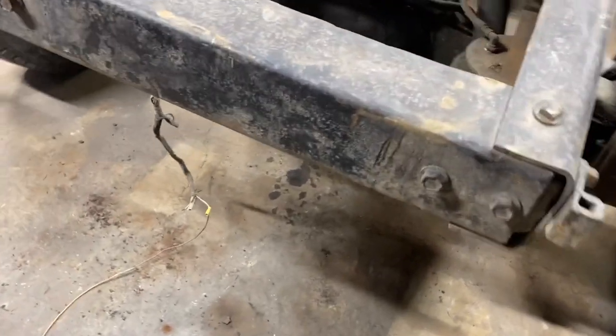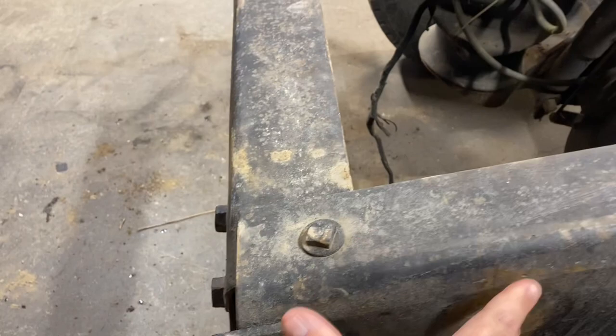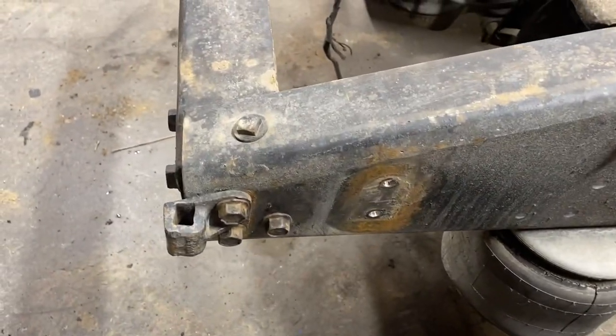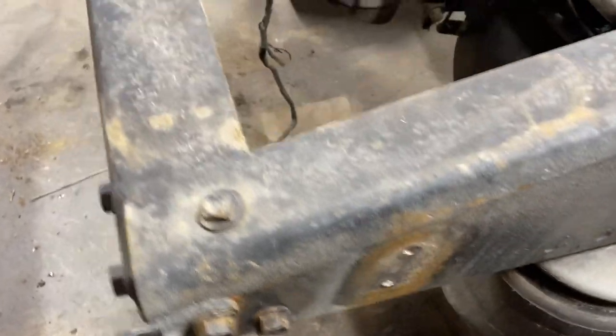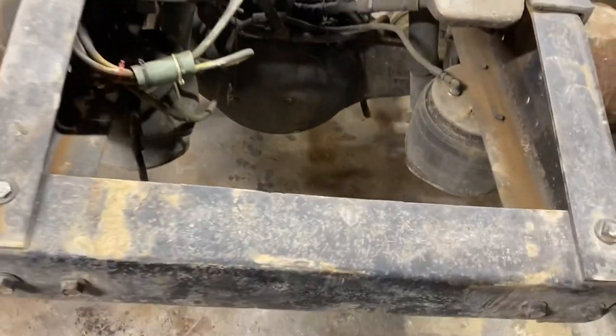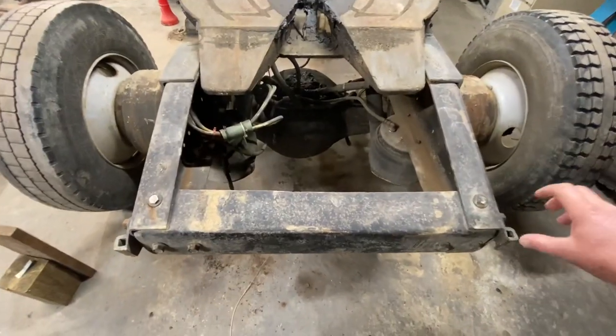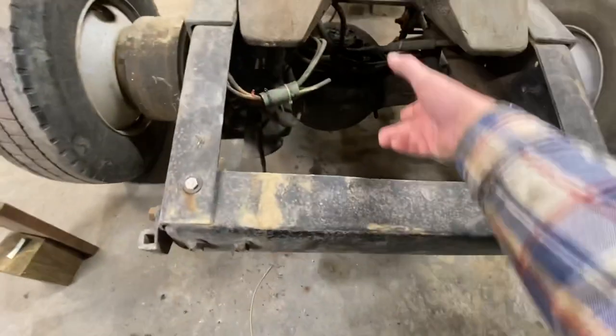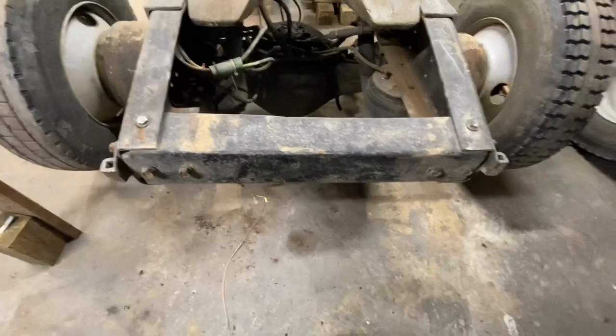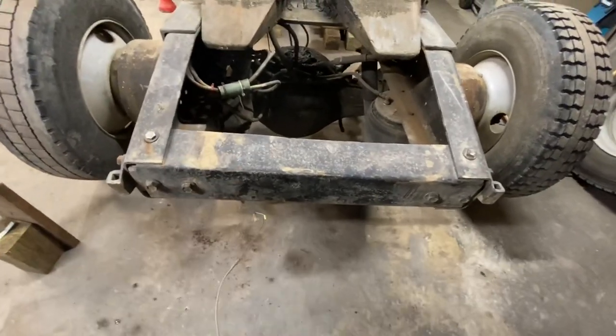But we're gonna have basically those plates come down here, down the side, and then we'll have those tube steel running laterally across. They're pre-cut to exactly 34 inches wide. So they'll run one right down here, one a little farther back. The hitch will tie to both of them. Plates coming down the sides. We'll probably do some more gusseting on that receiver tube. But anyway, that's all there too.